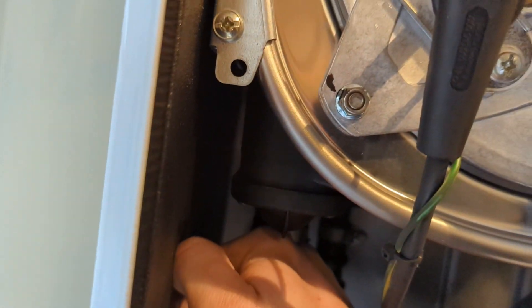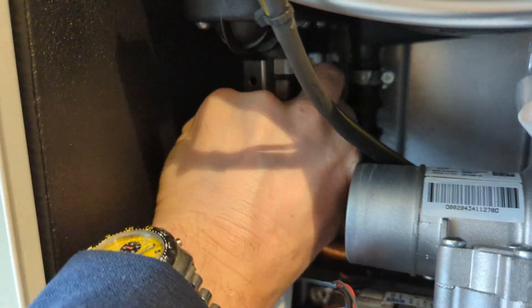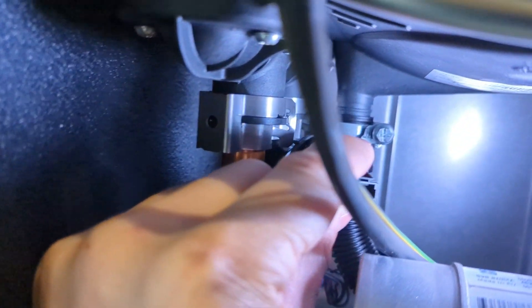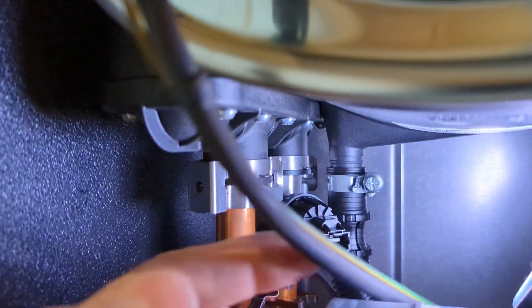Right, we get the new pressure sensor, but initially I just checked the housing which is pretty mucky, and we give it a little clean with a bit of tissue. That's what happens — you get muck inside the sensor and that causes the F75.